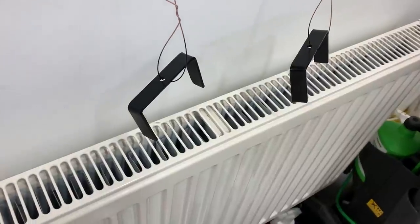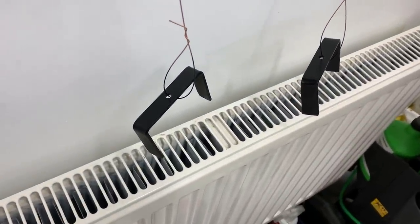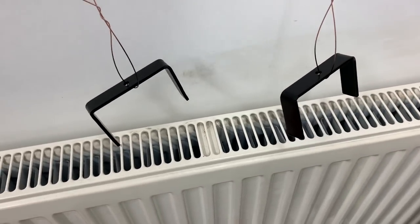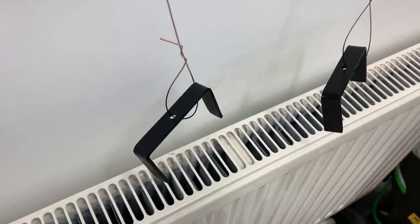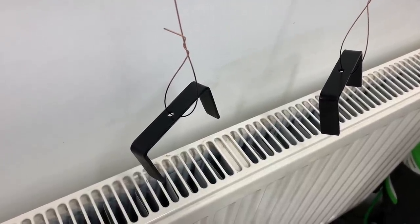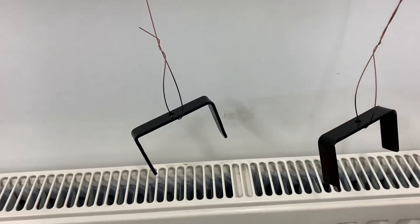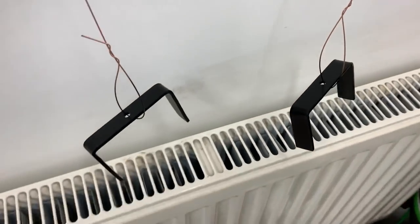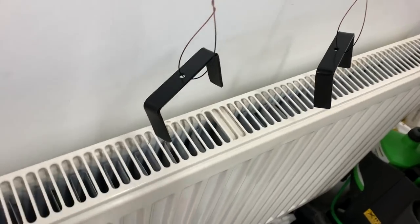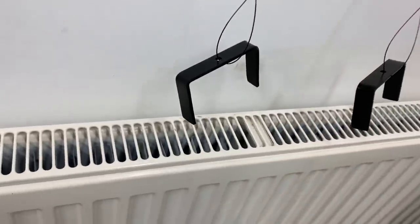Today wasn't supposed to be a garage day, but the wife had to go out with her dad, and there's always something I can get on with in the garage. So I decided to make these — the clamps that hold the rear light clusters in place. I didn't have any; I found them on eBay for about £28 a pair plus postage, over £30 all in. I thought, a couple of hours and I can make them. I made these out of 3mm steel — cut them, filed them, got them perfectly square, drilled the hole in the middle for the bolt, then primed them and painted them satin black. On the bottom of the feet, where they touch the body, I'm going to put little rubber feet so we don't have metal on metal.